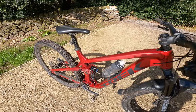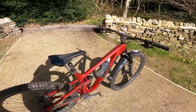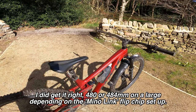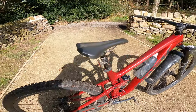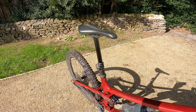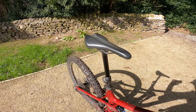This is a medium-large, which I think is a real positive with the Trek range. You get this medium-large size that's kind of between medium and large — so a 465mm or 469mm reach on this bike, whereas the large is around 480 or 484mm. You've got relatively short seat tubes, but they still run a long dropper post as standard — I think this is a 150mm. On the extra-large models they even run a 200mm shaft, and they've upsized the seat tube to 34.9mm so a longer stroke shaft is still decently stiff.